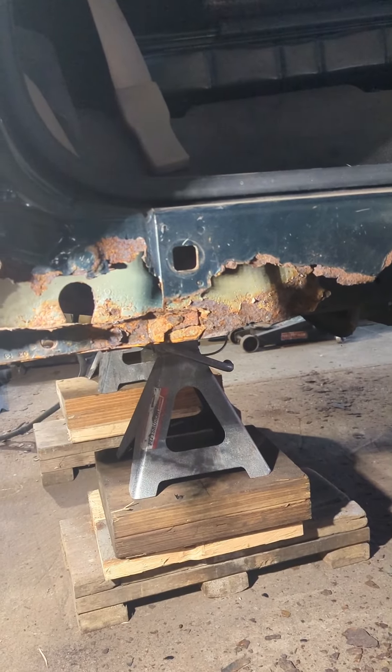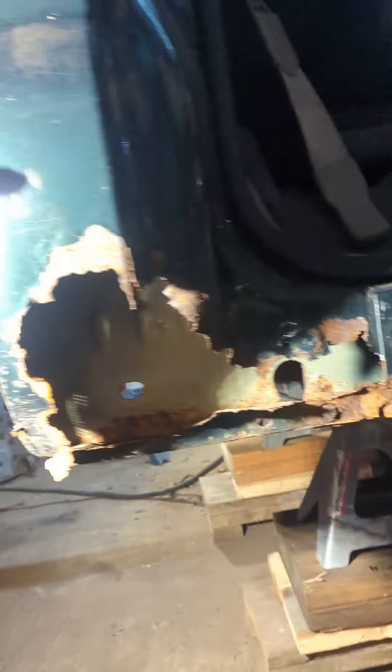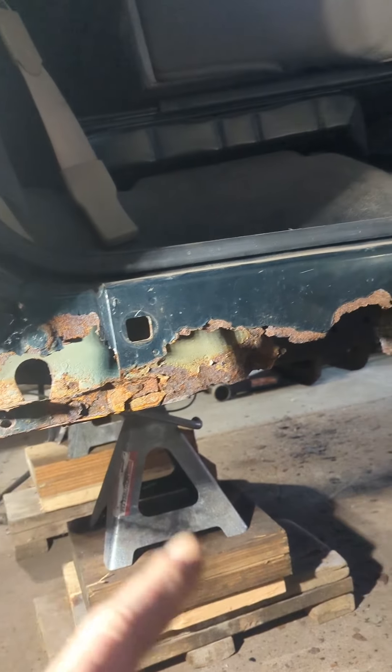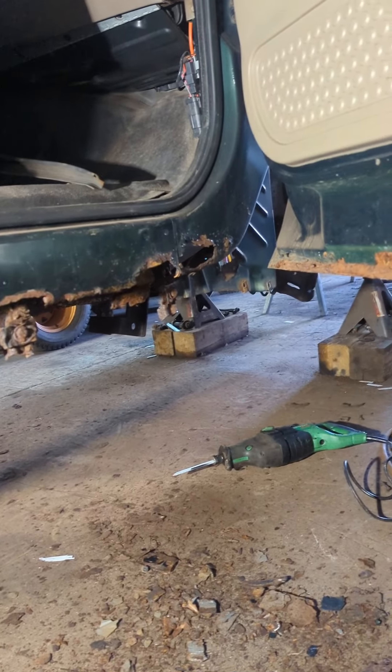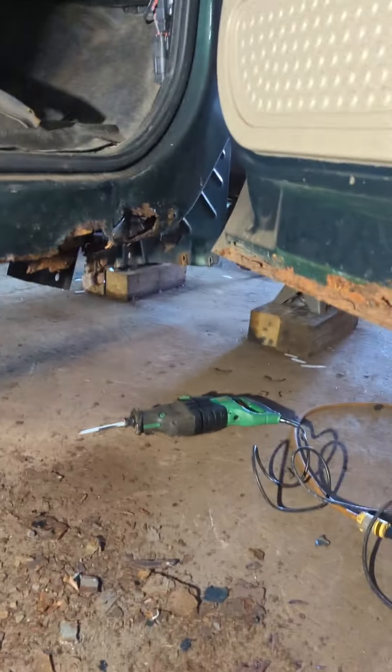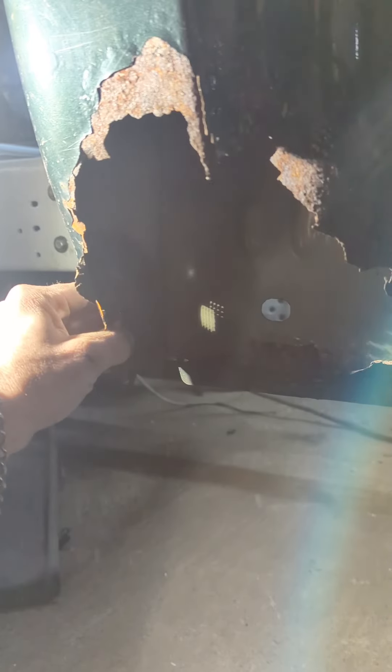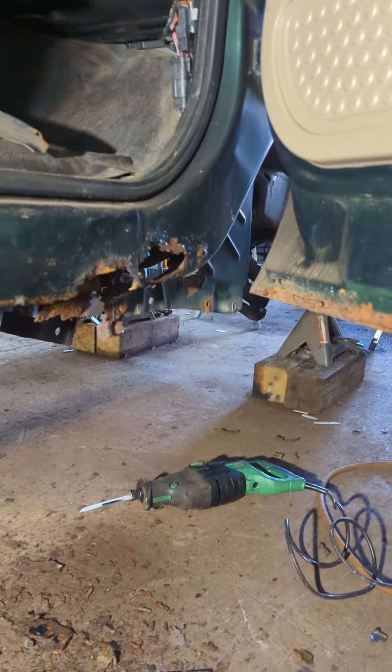What I'm going to do right now is I'm just going to cut a lot of the big rust out so that it's easier for me to get to the spot welds. Then I'll bring you guys back because I'm going to pull the weather stripping off so that I can drill out all the spot welds and pull this side off. I think I'm going to do this side first because it's not as bad as the other side — it's going to be some practice. Those parts should be in on Thursday. It is Sunday. Once I get this done, I'm going to get back onto the frame.